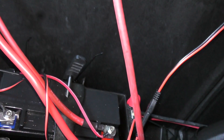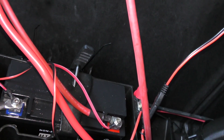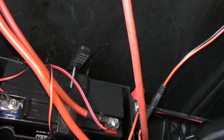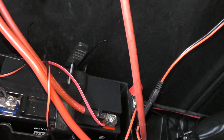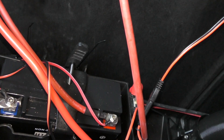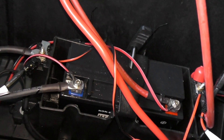Each battery has a cable for solar charging and they're all independent. The solar charging is independent of each other — they don't run in parallel, nor do they run through the switch. They're basically just two separate connectors. If I wanted to have two solar chargers I could, or just swap one and then the other.